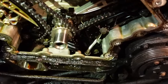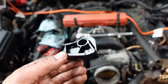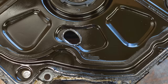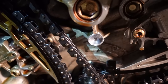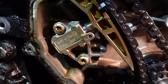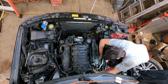Let's take a look inside — and the very first thing I see looks like a piece of the tensioner guide. The timing chain guide bolt broke off, then moved around in the tensioner, wallowing out a hole and wearing a hole in the timing cover. At some point the bolt probably hit the crankshaft pulley, causing it to break the timing chain guide. This would have caused oil to leak out of the engine, eventually causing the knocking noise we initially heard. The broken guide could be a factor in the timing chain noise, but I also notice the tensioners are the old design — so this engine may never have had the timing fixed. Once we get the tensioner guides off, we'll be able to tell for sure. I first have to remove the valve covers followed by the upper timing covers.